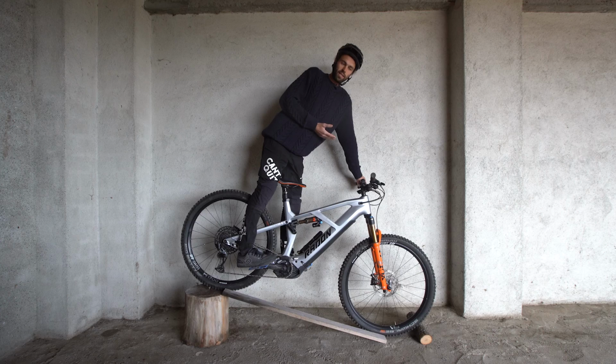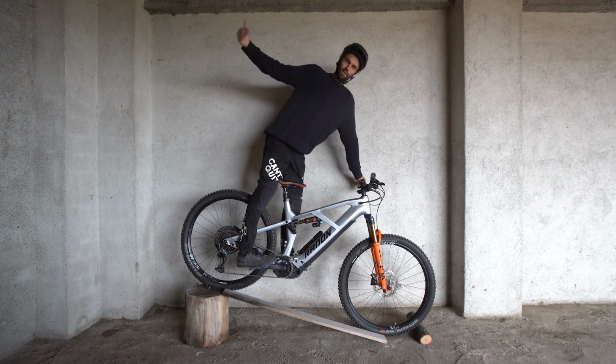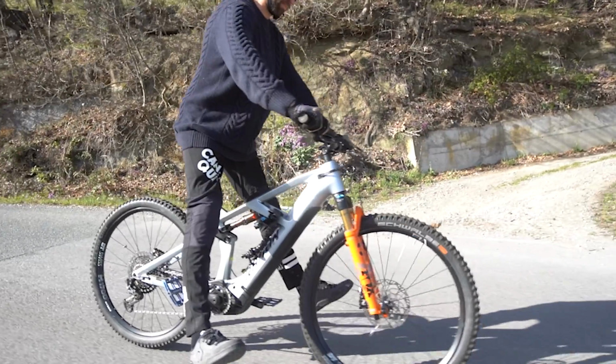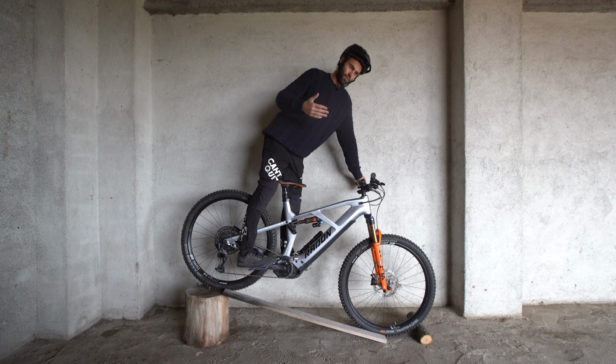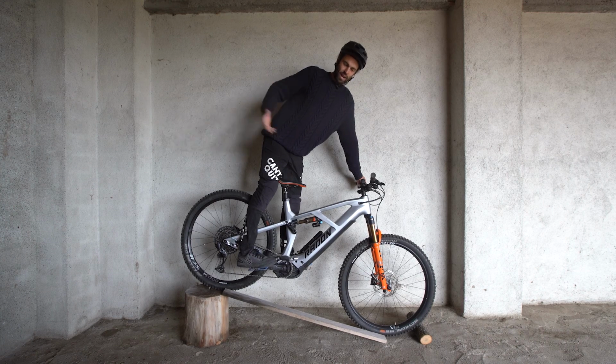This bike's got 50% anti-rise, so when you brake, the brake torque is allowing the suspension to move freely, but it's also allowing the main frame to pitch more forward. So if you ride down the road on the bike and pull the rear brake, you can even see the rear shock extending. So now we're going down the hill, stem's too long, the head angle's too steep, fork's too soft, and we've got a low anti-rise number to have active suspension.